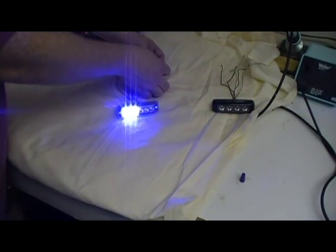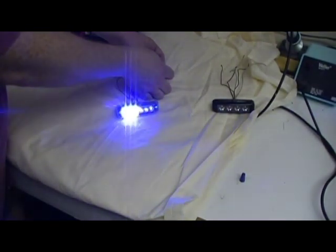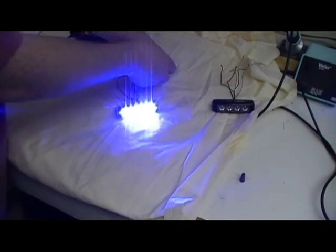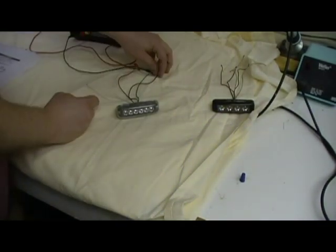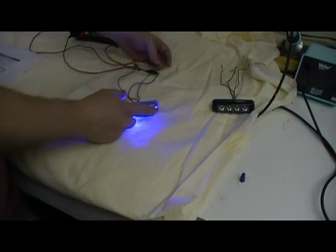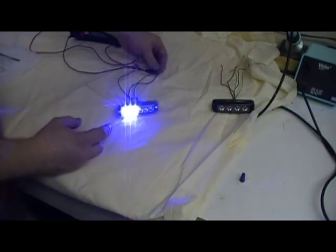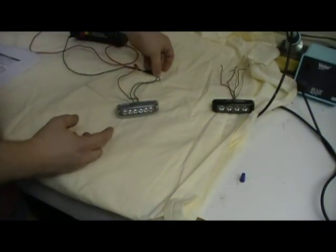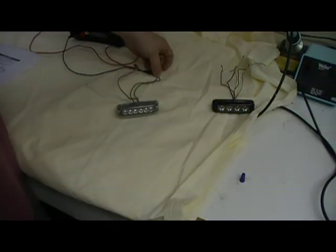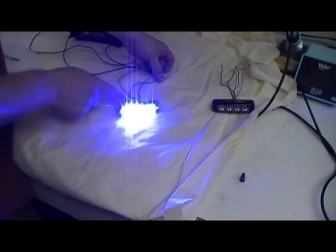If you want to change your pattern on the part that's flashing, just toggle the green wire to ground just like you would in flashing mode. It's still synchronizable. Now if you want to swap the sides — so that the currently steady side is flashing and the flashing side is steady — take your green wire to ground until it flashes five times. Now this side is steady and this side is flashing.